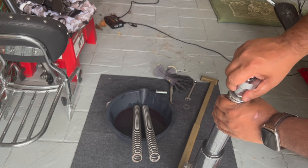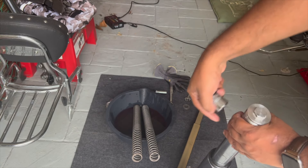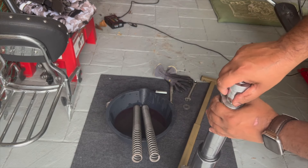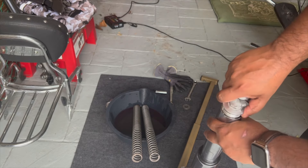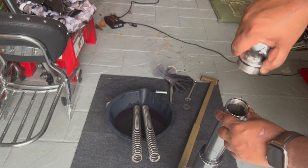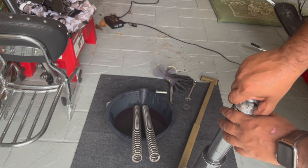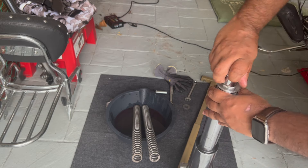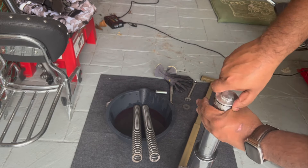The reason I like a palm driver is because there's a spring inside, so there's a little bit of pressure. As you loosen the fork cap and it detaches from the fork tube, there's a chance it might spring open and fly in your face. It's not that much pressure, but having your palm there puts some pressure on it to prevent it from flying up.